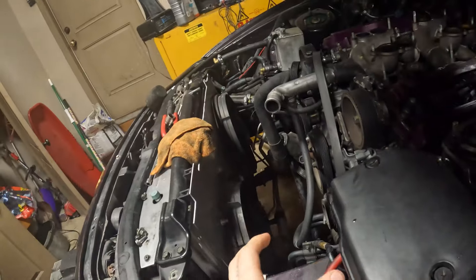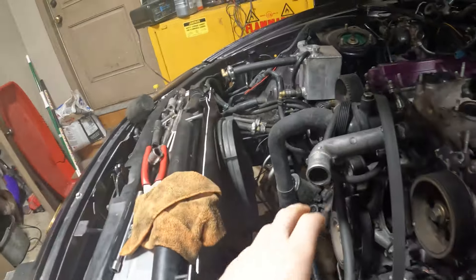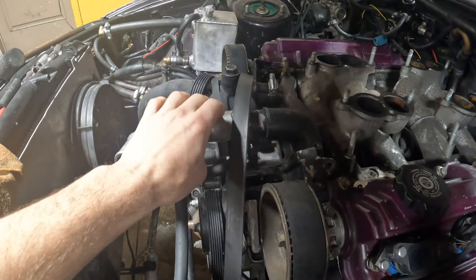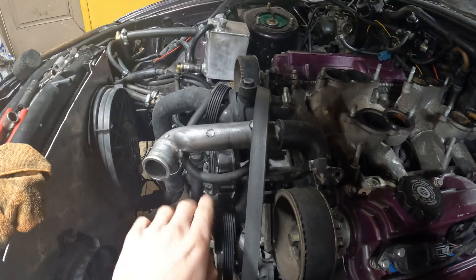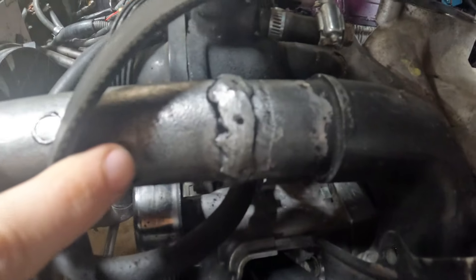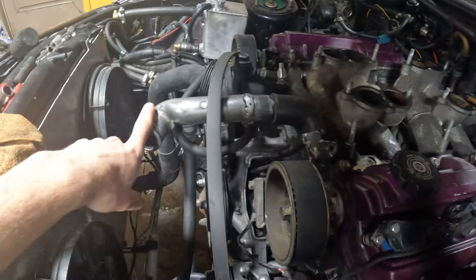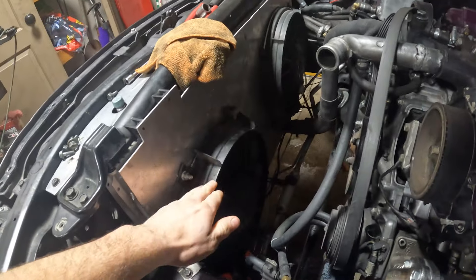New day, new hair. So last I showed we were getting the turbo placed in here and I'm probably gonna change this around a little bit. I extended the stock one because with the supercharger the belt was really close to it — if it was rubbing I didn't want the belt to rub through my radiator hose. You can see some belt wear from slippage, but this is kind of getting in the way of where I want to place the turbo because of how I have these fans.